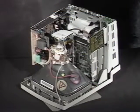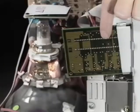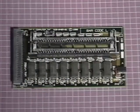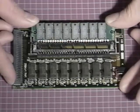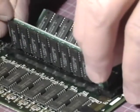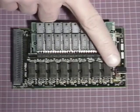You should already have the case off your Classic. Touch the metal frame to discharge any static electricity. Look to the side of the CRT and you'll see the memory upgrade board. Remove it by pulling it straight back away from the motherboard, then lay it down on a soft surface with the sockets up. Pick up your SIM by the edge of the circuit board, hold the solder edge down, insert the SIM into the first socket, and push it back until it snaps in place. Do the same thing with the second SIM. Now locate the jumper on the end of the memory upgrade board.